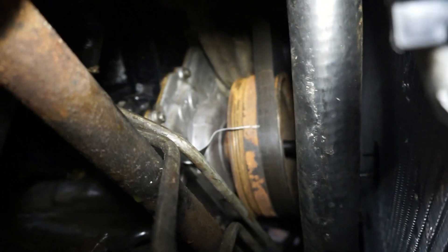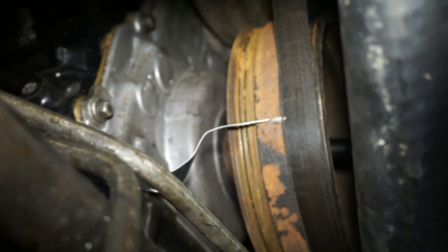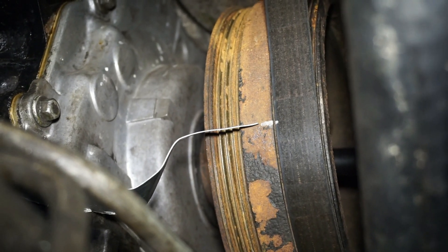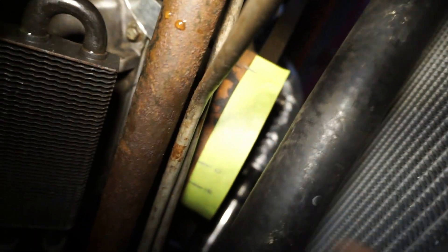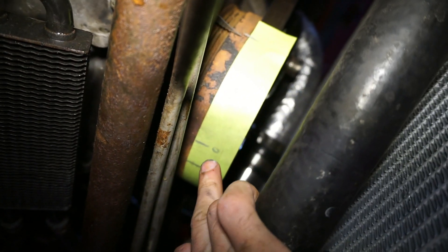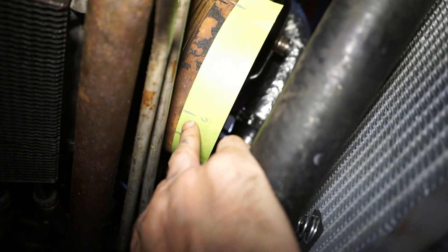So now I'm going to mark the balancer. Taking a look underneath — I just cut a piece of sheet metal and made a little pointer. That's my mark that I'm going to be using. That's the first mark. Now I'm going to turn the other direction till it stops again, make the second mark, and then we'll divide it. I marked the balancer — there's one mark, and the other mark is up on this side. I laid tape over and marked where the balancer marks are, removed the tape, laid it down, used the tape measure, and measured it accurately to find the center. It ended up being about four and an eighth of an inch to center from the mark.